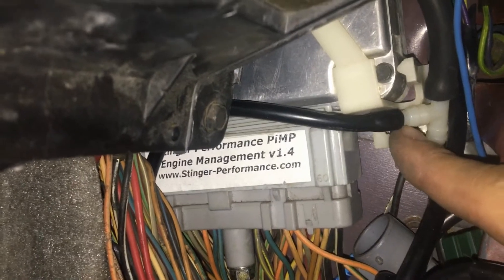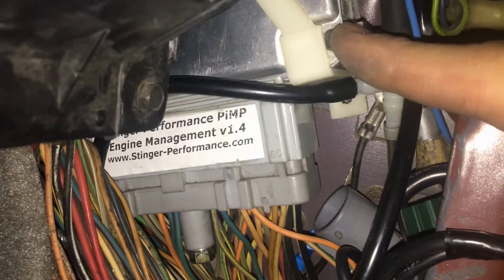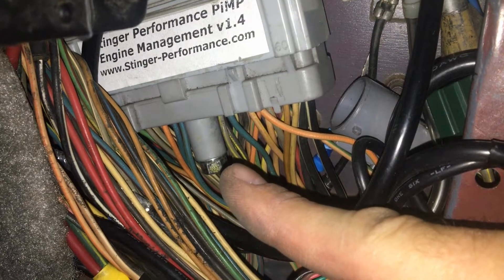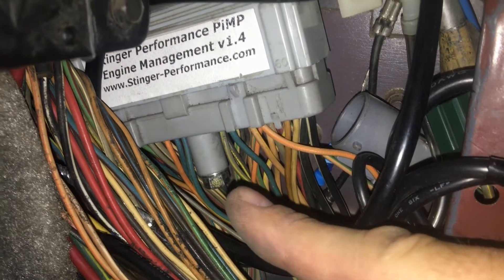I've removed mine for easier access, but those clips usually hang on to the back side of that panel. Your ECU is back up in here. Your ECU is held in with a bolt right here that holds this plastic piece in. There's usually a ground wire on it. So you remove that, then you can remove this bolt, which will remove the electrical connection from the ECU, and then you'll be able to wiggle the ECU out of there. Be careful not to damage or break anything in the process.